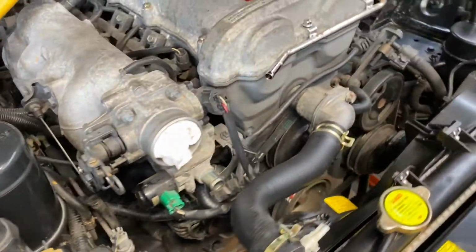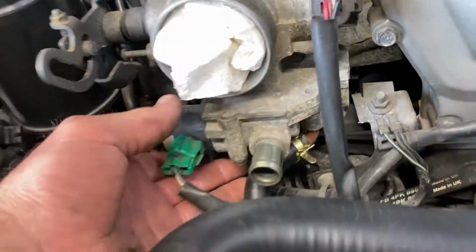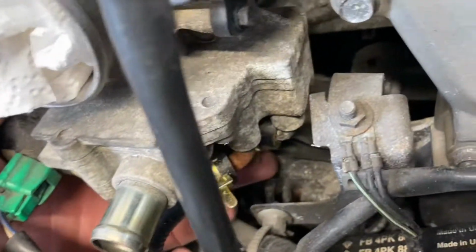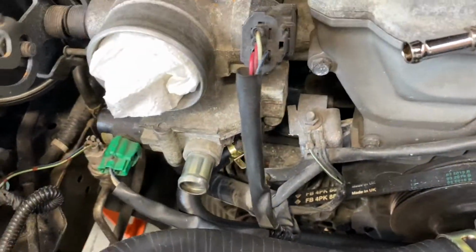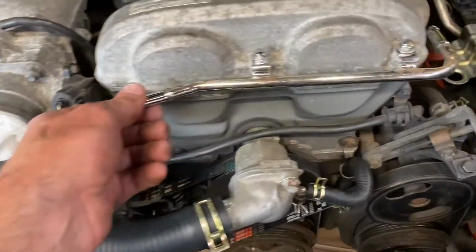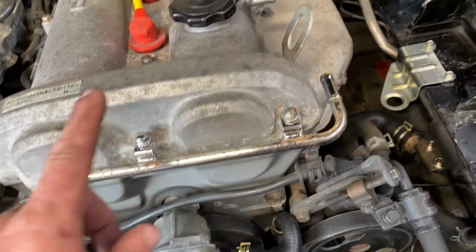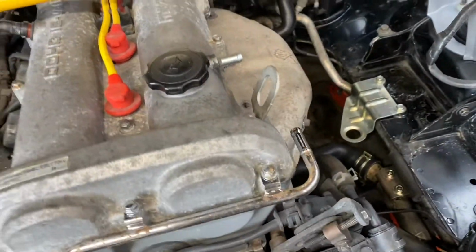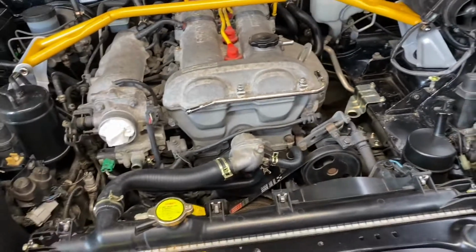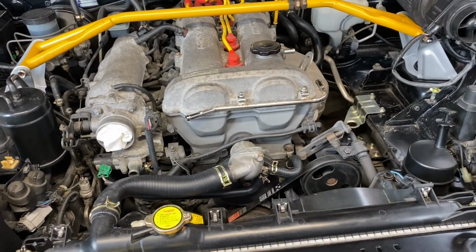Yeah, that's it. One down here, this one here, if you can see my finger touching it, that one there goes basically right by the oil filter. So I had to remove that bad boy to get it out. Good times. So it's only 3 bolts, but I might leave that out actually because it's easy to change the oil filter. So I just got to do this one and then put the intake piece back in, and then I can start flushing it. So that's where I'm at right now, and can continue.